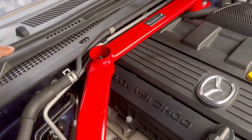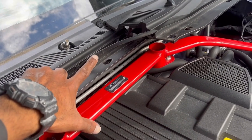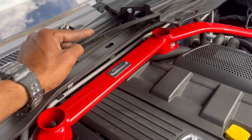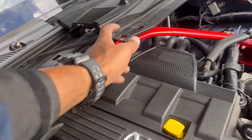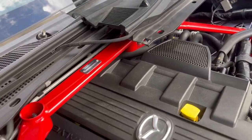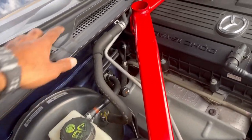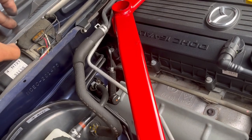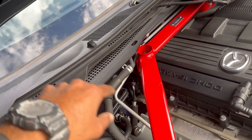As you're removing it, you're going to see the windshield washer hose that's connected there. There's a little plastic coupler — disconnect it there and you'll be able to separate the two halves. And for the part where it attaches on the other side, there's another coupler underneath, so you'll need to look underneath and disconnect that, and then you'll be able to lift this whole thing out.